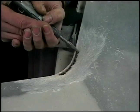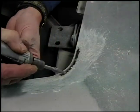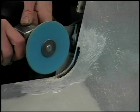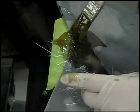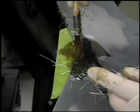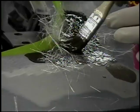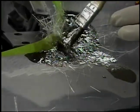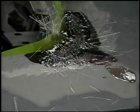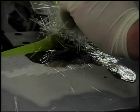The earlier repair was so thin that it just fell in as soon as the panel was stripped and there was actually a hole here. So the process now is you have to grind out all the body filler that's in there. You have to put fiberglass on fiberglass — it won't stick to the filler, it won't be a good repair. So they grind out that whole area, make sure it's a nice clean repair, and then you back tape it from the inside and start laying in the fiberglass strand again using resin. Resin first, then the fiberglass strand, just keep repeating that process. Then you have to work the edge of the inside where the hood butts up against it and do the same thing — make a sort of pattern with your tape behind it, keep working in the fiberglass mat and the resin, and keep trying to get every air pocket out of there. It's a tedious process but worth it in the end.